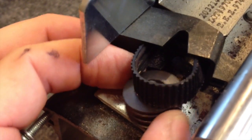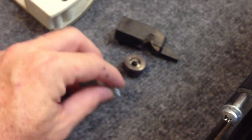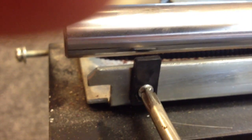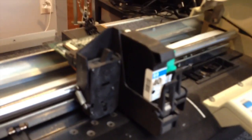Got it loosened up — I can now drop the pulley away from the belt. Take out the carriage and set all that stuff aside. Right in front of all that is the plastic cam actuator — this is a very delicate piece of plastic and you don't want to break it. I've had to replace it several times. It should not be put on that tight in the first place, so it should be easy to take off. When you put this back on, remember not to over-tighten that screw or you will crack the plastic. Put that aside.